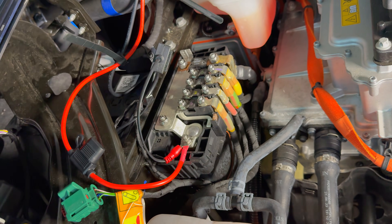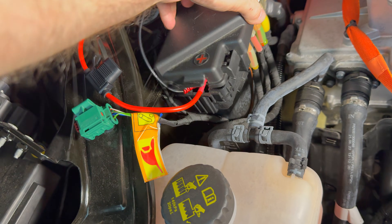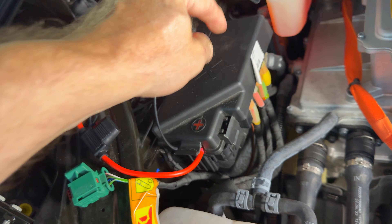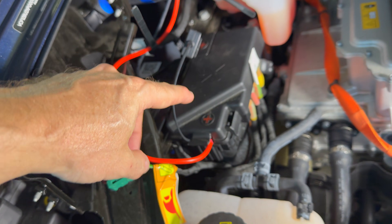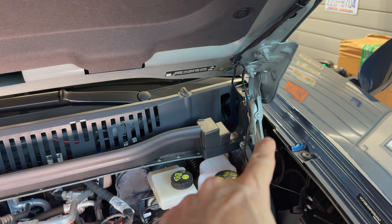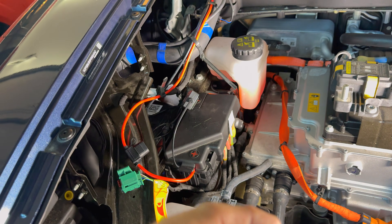When you're done with all your wiring, take the cover for the bus bar and reinsert it — it will snap back into place. Notice that the wires now come out the side and the cover stays in place without needing zip ties. Then carefully press the latch to lower the hood, attach the two bolts, and you're all set.